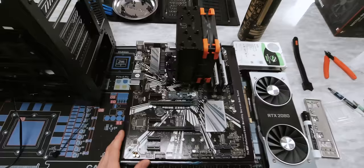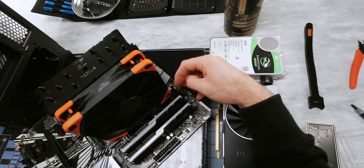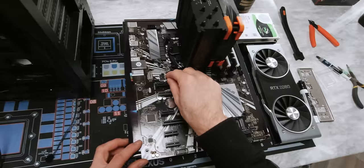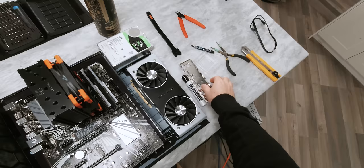And then there was one more — it's labeled AIO pump, but that's fine, we can still put a fan there. So our rear fan we're actually going to plug into this one, and then our two front fans we're going to plug into these two. Unfortunately that means our cable management is a little bit trickier because we don't want to just drag them all the way across the board. So we're going to go under the motherboard and then up over here for a nice short little run. That's why I'm running these guys right over here. Now it's time to install the motherboard.